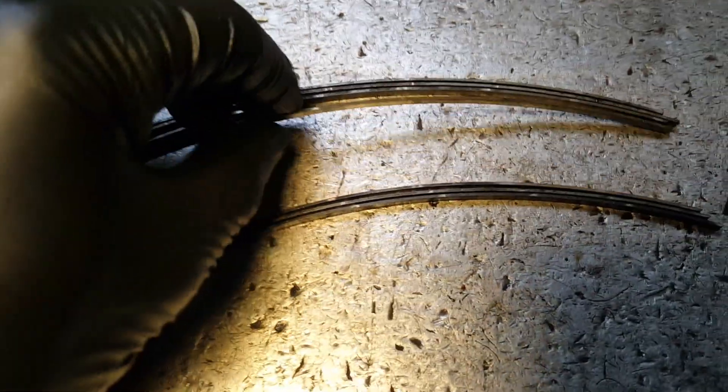These are cut by size, already cut by Mazda, so you don't have to file it down or resize it. On the Mazda RX-8, you look up the stamp on your rotor and that's how you order those side seals.